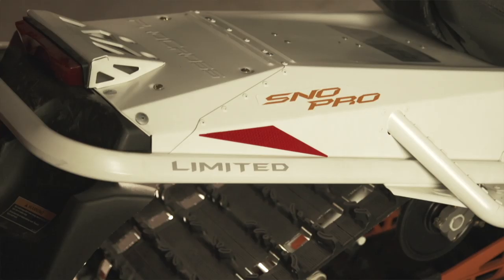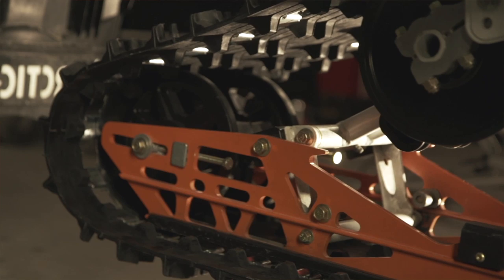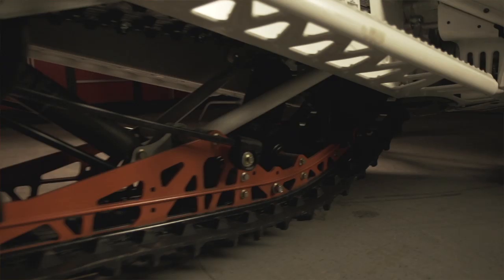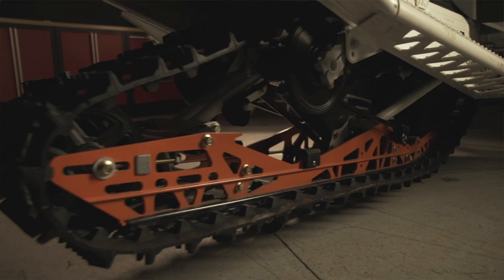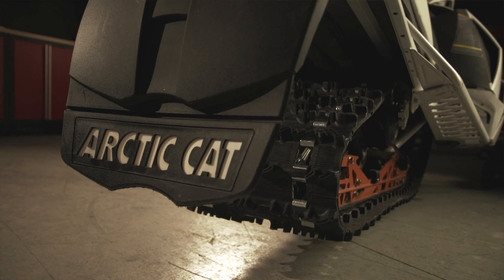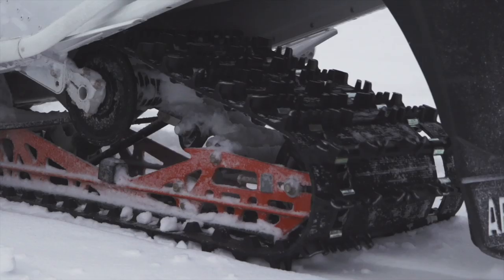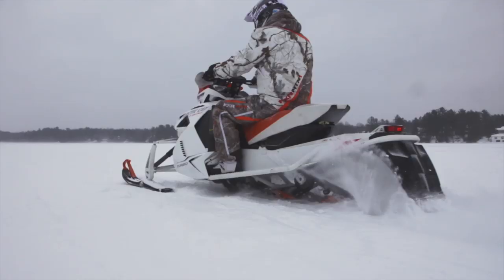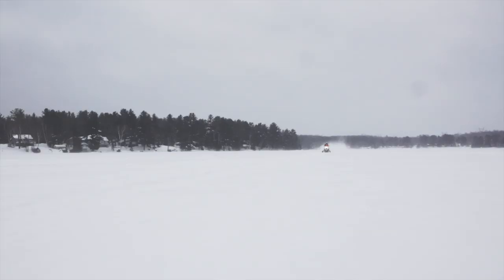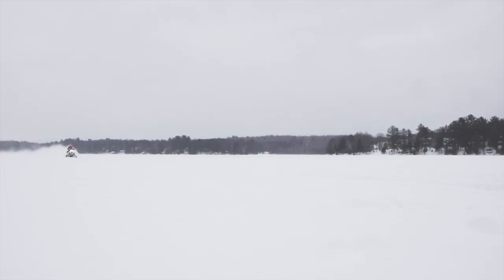With the new Hacksaw installed, you can visibly see less track outside the slide rails, particularly noticeable at the rear wheels. While half an inch on either side doesn't seem like a lot, out on the lake this should increase top speed by a couple of miles per hour. Setting the boost to stage four, after a few break-in runs the results showed a reduction in track resistance and the roll-on bite was noticeably less than with the original studded track. While it's hard to put an exact number on it, we saw somewhere around three to five miles per hour improvement at wide open throttle.